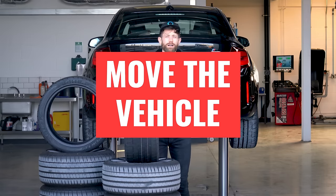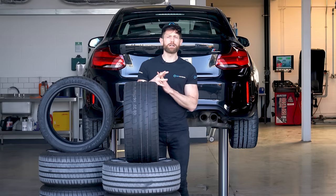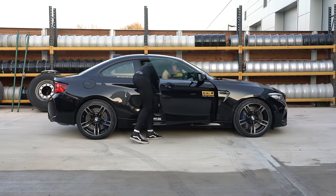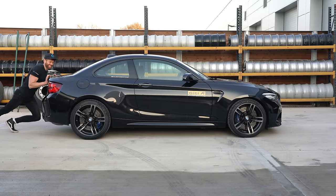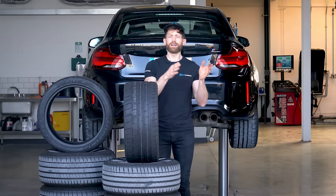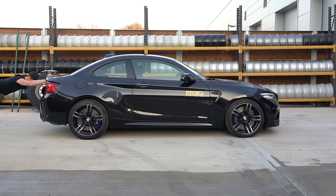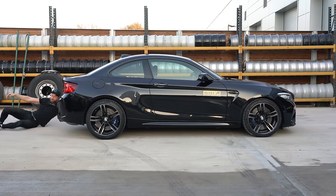Tip 4: move the car. Now you've over-inflated the tyres, the next step is motion. Assuming you're staying at home, now's the time to do a little bit of automotive exercise. If you can safely, take the car out of gear, take the handbrake off, and roll it backwards about 30 centimetres. Do this maybe every other week. If your car's laid up for multiple weeks, make sure you don't roll it back onto a previous spot — vary the position each time. The motion will really help prevent flat spots.